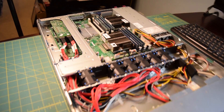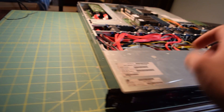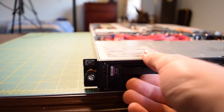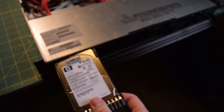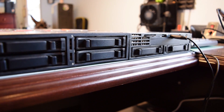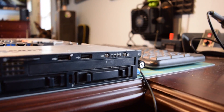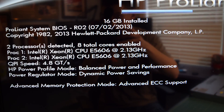Isn't she gorgeous — that is what I call a clean machine, inside and out. On the outside there are no noticeable blemishes, no big dents. There are a couple scratches here and there, but besides that really, really clean on the outside. Starting from the front, we have a single 146 gigabyte drive. I'll pop it out — it turns out PC Server and Parts shipped this over with a 10K drive. So that is our single 2.5-inch 10K 146 gigabyte hard drive. We also have seven additional drive bays where we could add more 2.5-inch drives. On the front we have two USB ports, indicator lights, and a power button — Intel Xeon inside.